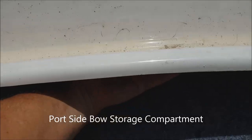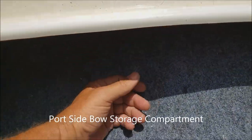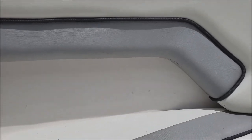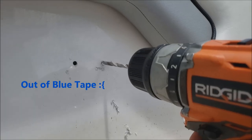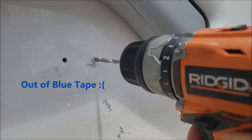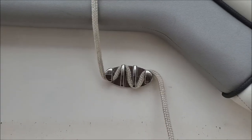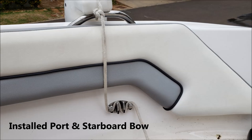To install, you have to search up the side of the bow under the storage area to make sure you don't hit anything, and you can put a nut and washer on the back side and screw everything down tight. Here I've put up my pencil marks and drilled one of the holes — this time I didn't have any blue tape, I ran out. Remember, don't go too far through because right beyond this hole is the actual outer hull. And this is the finished installation. You can see the fender line coming through, it wraps quickly around, and at the top there is a low, low fender.